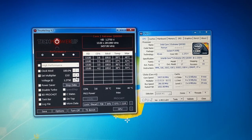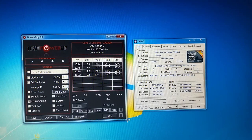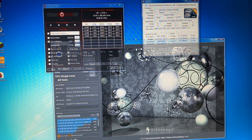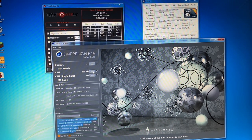13 — 3.46 GHz, still going. 13.5, now at nearly 3.6 GHz. 14 — 3.73 GHz. And that's where it went. I did try increasing the voltage just a little bit to 1.3 V to see if that would give us even more headroom, but we got the same result — 3.72 GHz maximum. Which is really amazing — we're talking a GHz over stock speed, even if it isn't 24/7 stable. For that I did some more testing and found that at 1.275 V I would get an all-core overclock of 3.46 GHz, and in Cinebench R15 that scored 373 points — nearly 33% higher than stock.